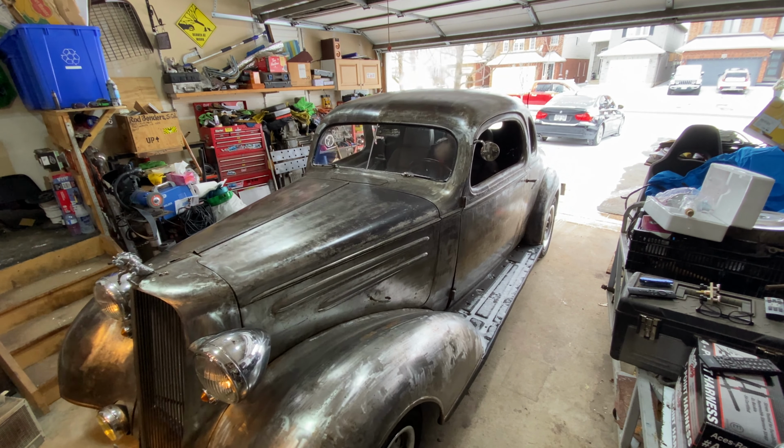Okay, next step then. I want to mark exactly where this is pointing so that when I install the new one, I shouldn't really have much timing to take care of. So let's mark this, and then I've got my 14mm nut holding this down, and then the whole thing will come out. My little bracket is now removed. The whole thing will now lift up, but remember the bottom of this sits in oil, near the oil pump. So make sure you get a rag handy.